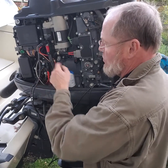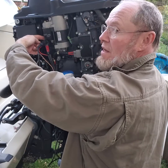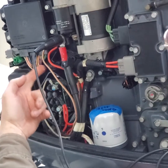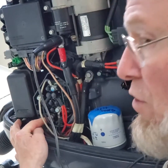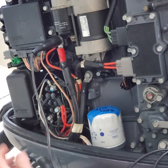I'll zoom in — there's a connector over here, a tan and light wire that comes off the backside of the solenoid. It snakes down and goes to a junction block, which is actually a terminal block. If you pull the little rubber cap off that covers it up, you can put the other end of your starter button on it.